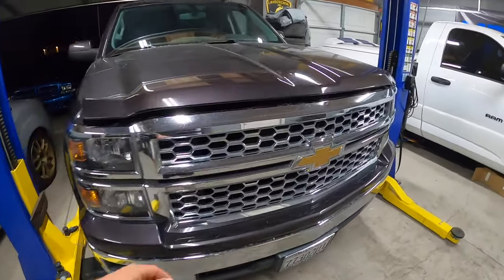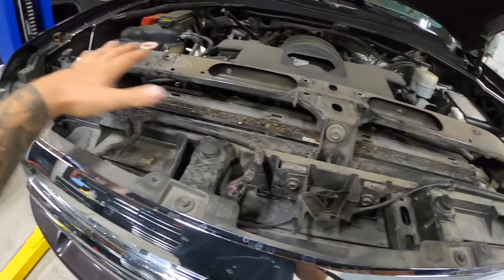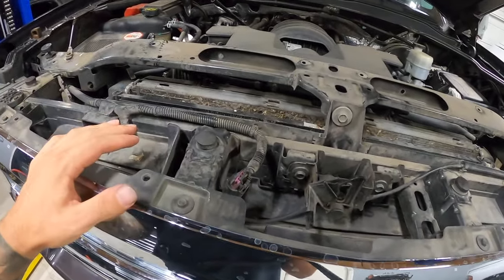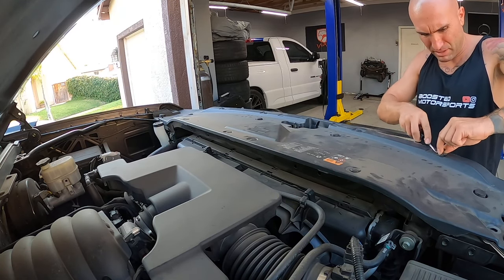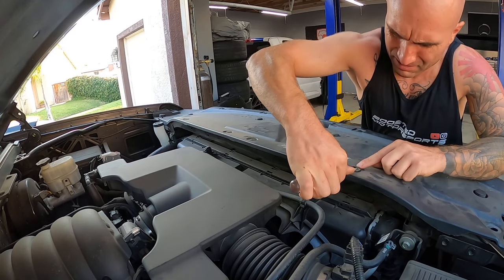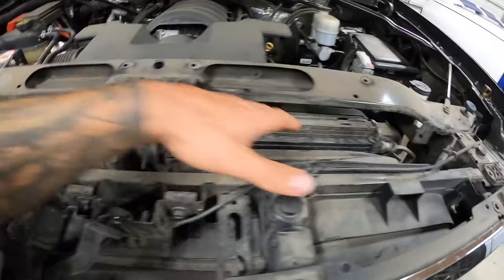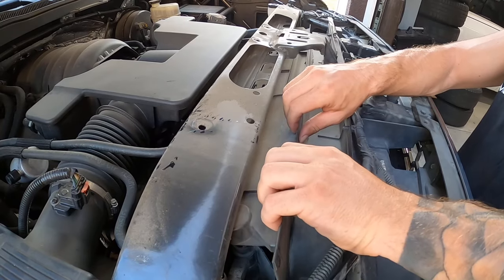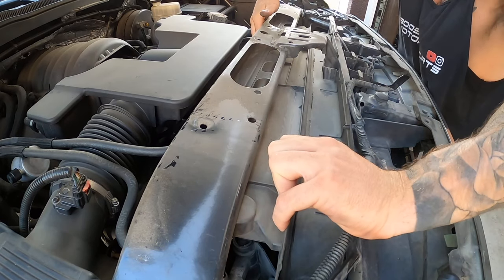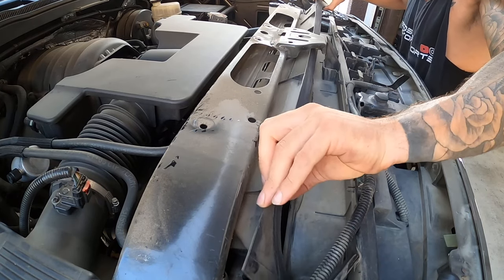This thing has a hundred thousand miles so we're stuck doing it this way. I've already removed the heat shield panel that goes on here — it has a series of clips and it's pretty straightforward to remove. You just lift up the center and then you can pop the whole tab out. You can do it with one of these pry tools or a flat tool. Lift up the center, take the whole clip out, and once you remove those the panel pops up all the way across, and now we can fully access our condenser.